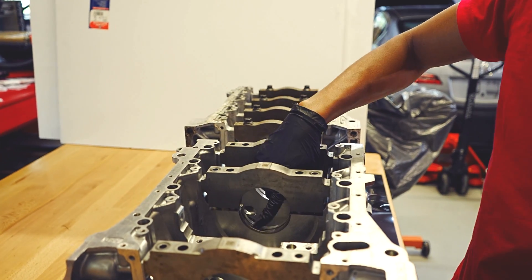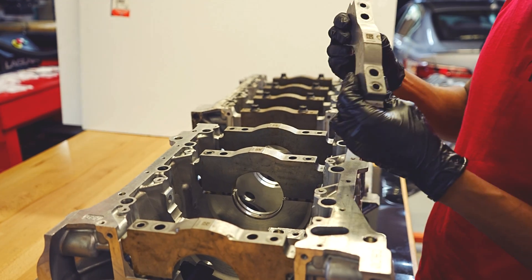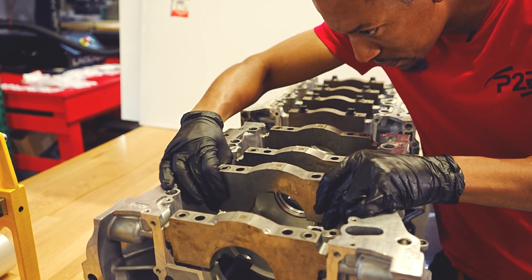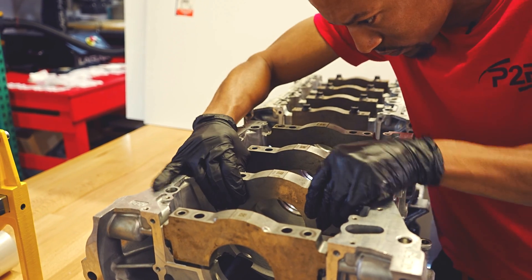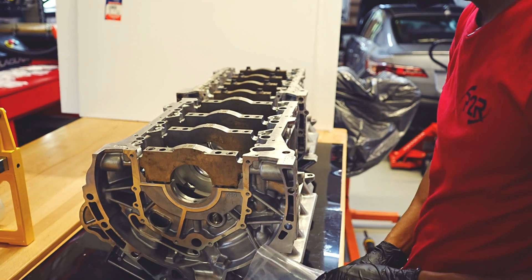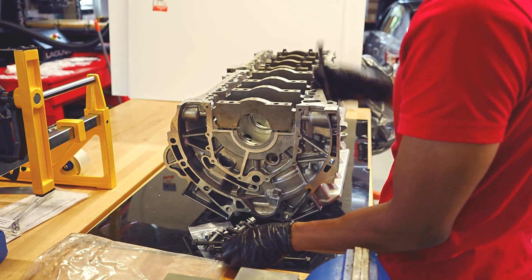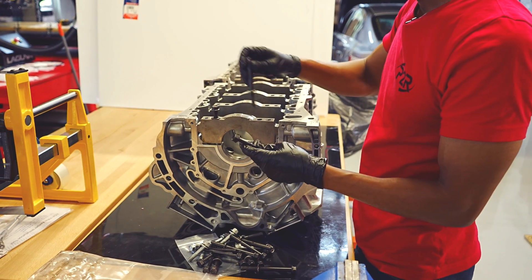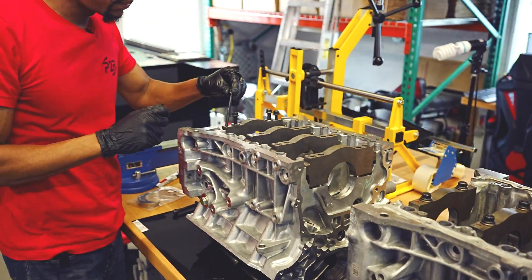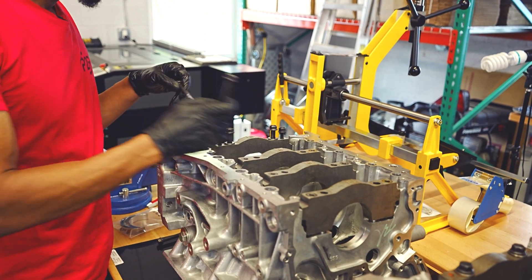A couple of these have a bearing in them — I was just test fitting the bearing from a previous generation motor so that when I rested the crank in there it had a surface to sit on. This is number three, arrow facing towards the timing belt. I'll just rest this one in place. We got the two bigger bolts and we got two smaller head bolts — these look like about an eight millimeter, and these are about a ten millimeter.